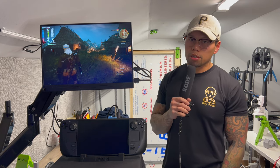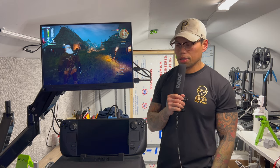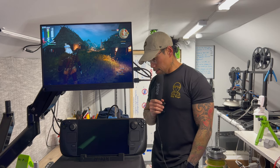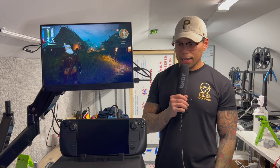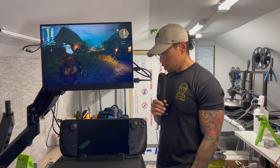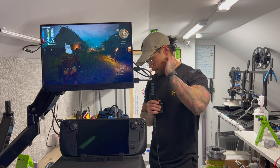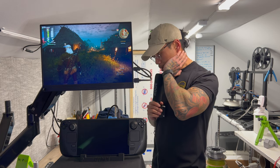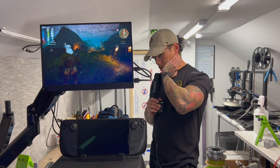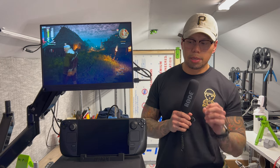With the dB measurements: docked on low, docked on medium — audio is the same, around 36 decibels right up front, 25 dB at a foot and a half away, which is just room noise. So docked, no dock, medium — all the same dB. When we go to high speed: 38 dB right at the Steam Deck, 28 dB at a foot and a half which would be your normal playing distance, and 26 dB at about three feet. So for noise, you're better off just going medium.